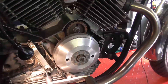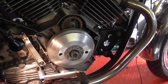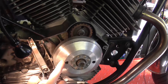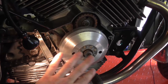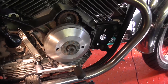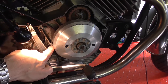Now this isn't the only way to time the engine — or rather I should say there are two different ways to time these engines, depending on whether they've got an electric start or not. This is the machined style flywheel, the earlier narrow flywheel. If it hasn't got the drum for the starter motor, you time it the same — you time it at the back.